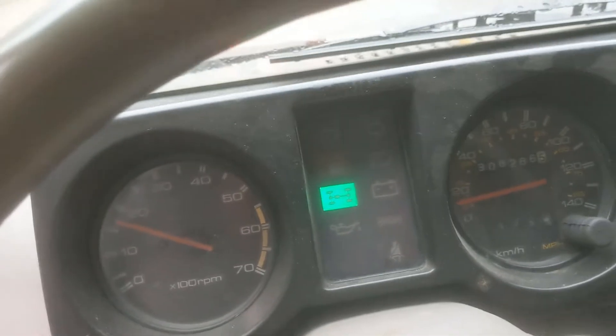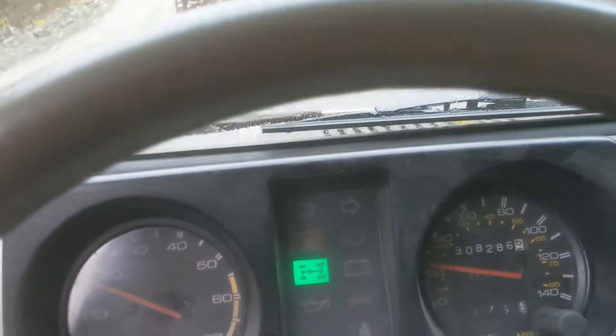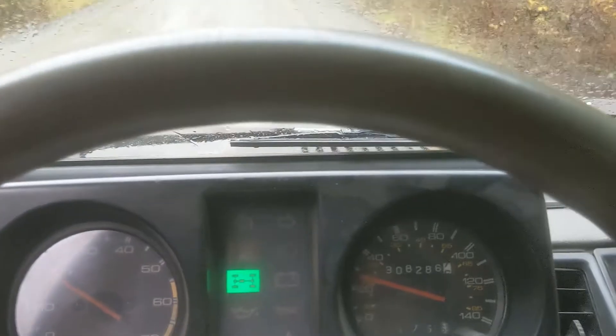It's causing the Weber to flood out because the vent of the Weber goes straight down into the throttle bores. So that's where I'm at — trying to get it back out to the road and get her home before I kill my starter out here on the trails. Next video we're going to be looking at a fuel pressure regulator for this thing and a couple of tricks for making a Weber carb climb hills. Anyway, thank you for watching and I hope you enjoyed.